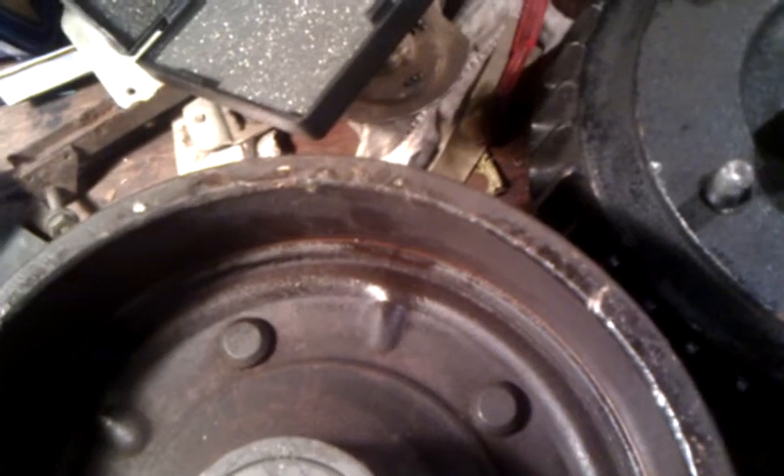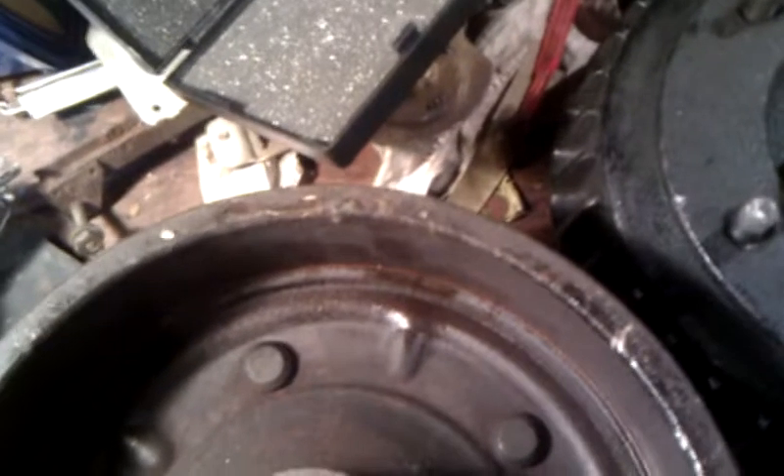Having said that, I've encountered many drums that have come off driving cars — converted to HQ front ends or similar — with drums that were actually 60, 70, 80 thou over, which is a good 50 thou over the condemning limit. That's very dangerous because the drums get thin at the base of these ribs, thinner and thinner until they crack and fail along this innermost rim. Suddenly your drum separates from the hub, and I know from my own club — the FXFJ Club in Sydney — that a number of people have experienced that.